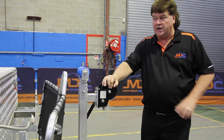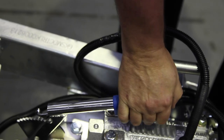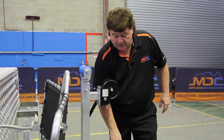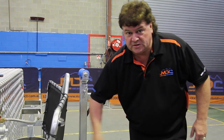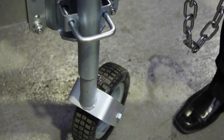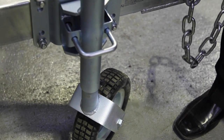So we've got to the stage now where we've found a good level campsite and unhitched from the vehicle. Make sure you engage the handbrake — it'll stop the trailer moving around as we open it up. If the trailer's got to be moved, always ensure that the jockey wheel is in the fully lowered position. That's its strongest position, especially for a sideways movement. At that point, we can move the trailer around where we like.